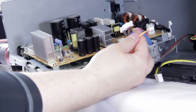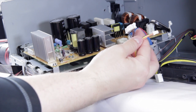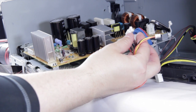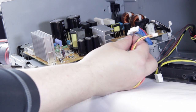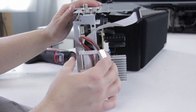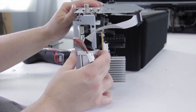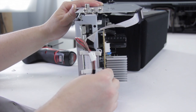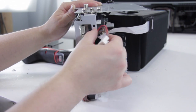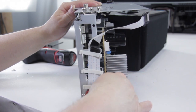When you've got to pull the chassis out, sometimes it can be a little tough. These cables right here are actually taped down — if you need a little more room, you can gently pull on this and lift the tape. That'll give you enough room to get your hand back there and pull the chassis out. Take these clips and squeeze them in and they should pop out — pinch them and pull them, and then you can remove the power cables like so.